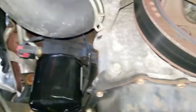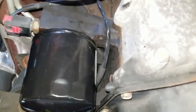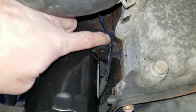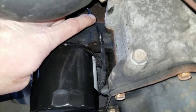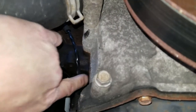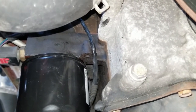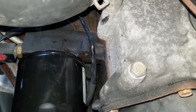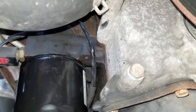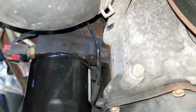You can see from a better vantage point looking from the front of the engine — there's the crank pulley, there's the oil filter — and that wire right there is that same part of the harness. You can see it's kind of rubbing on the engine block right here by the oil filter housing. That gets hot when the engine's running, and between friction and just the heat, it's probably cooked those wires right there. So if I had to bet, that's where I expect to find the problem.